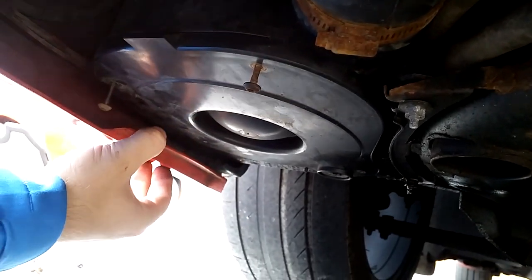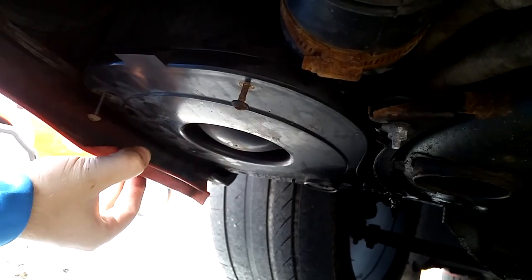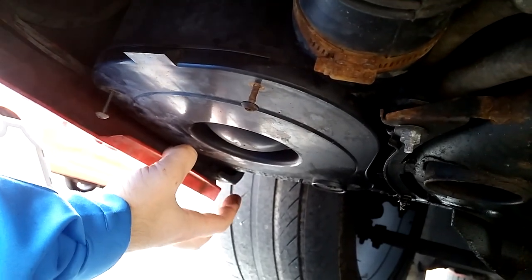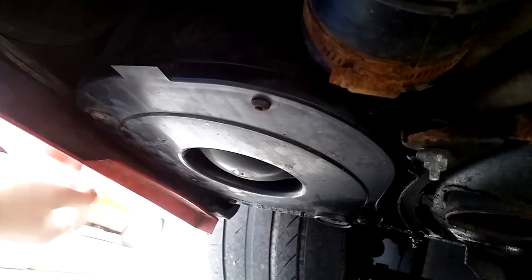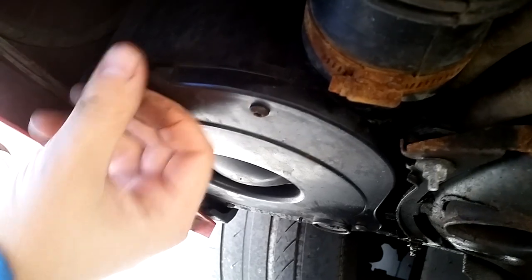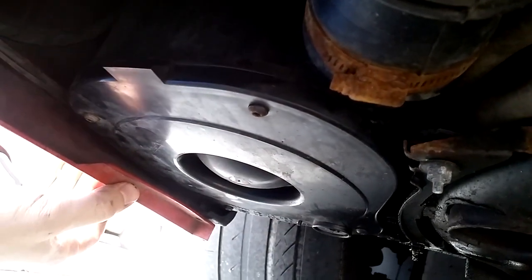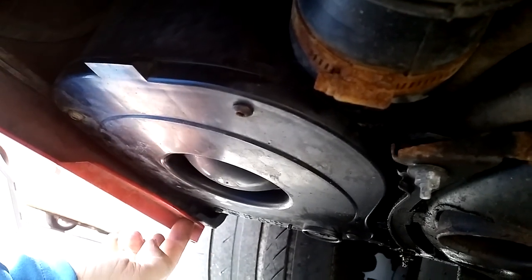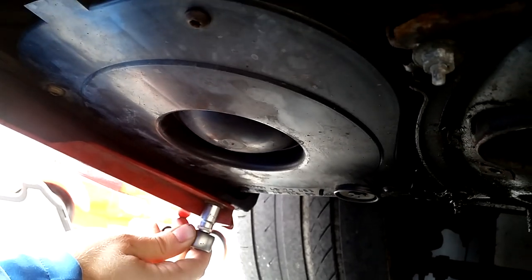The cover is back on with the filter. The only trouble you'll have is if you have the sports skirts like on an Aero — you'll have to pull the spoiler to the side as well as the plastic clip in the back. Otherwise it's just easy sailing. Put in the Torx bolts, making sure the filter housing is snug all around — you don't want any dirt or debris getting into your engine. Then put this bolt back on the spoiler, and done.